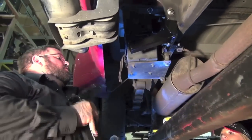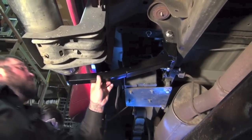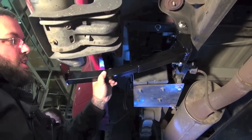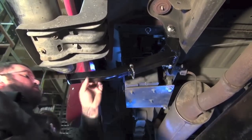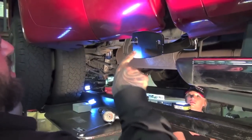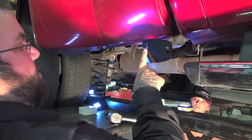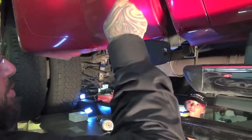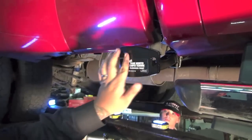After everything is torqued to the specific ratings, you will insert your inserts. Depending on how far your turnbuckles come down, you have two separate locations to pin — your first and your second. One key fact: the bullet plate always faces towards the front on your front units, and towards the rear on your rear units. You have two locations to hook your turnbuckle to get the most pulling angle. You have two stickers in your front kit — driver and passenger front. We did the passenger install, so you install the passenger front sticker.